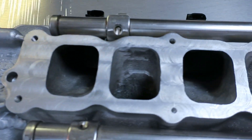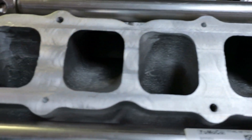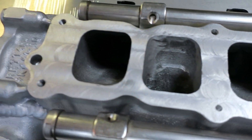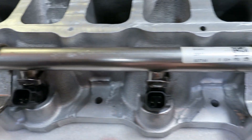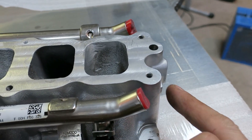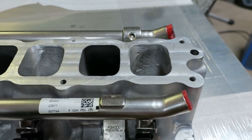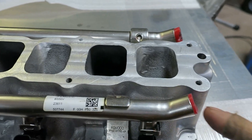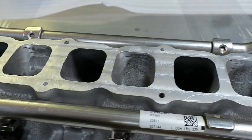I blended the ports open in the top of the manifold to make them a little more uniform. I've got the fuel rail here from the Lincoln engine — had to cut off the back of it. I'll weld some AN fittings on there later. The crossover shape was going to interfere with the base plate for the plenum, so that had to be addressed. Next step is mocking up the plenum.